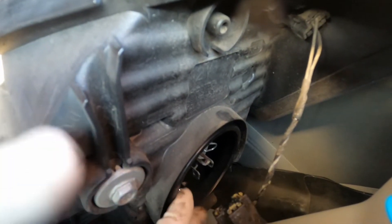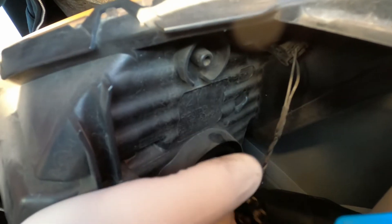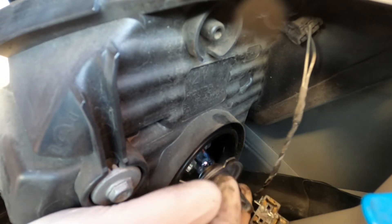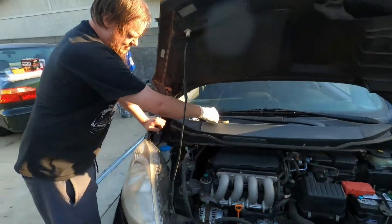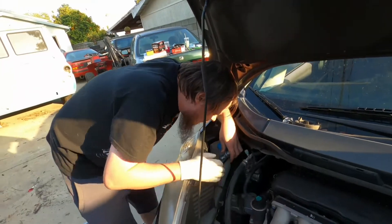You can kind of see the clip — I'll point to it. So the clip is right here, that's the back side. If you push on this and flip it like that, you can see it swings out and that removes our factory bulb. So that's literally it — it takes a very short amount of time. And then the new bulb goes in quite literally just the opposite.